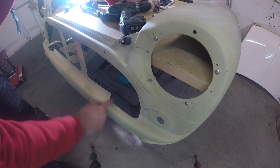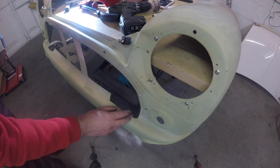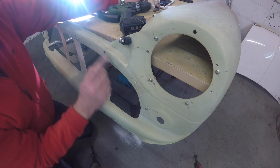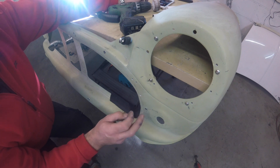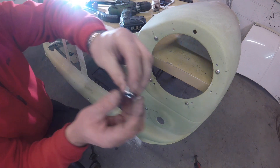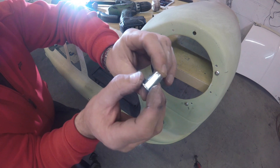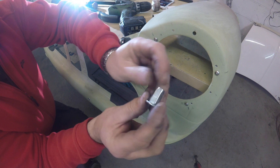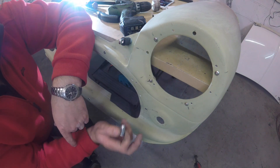That area is now prepared. I just need a little bit of clearance around the gearbox mount. You may be able to see a series of rib nuts around the perimeter of the grill — it just makes life a lot easier using nuts and bolts. Rib nuts: if you're not familiar, you use a swaging tool and just pop them into a suitably sized hole, squash them, and they get fixed into the panel. It's then very easy to just screw the grill up into them.